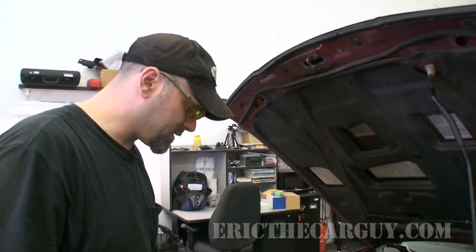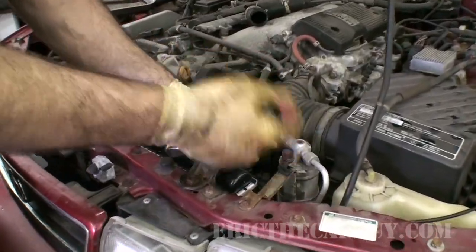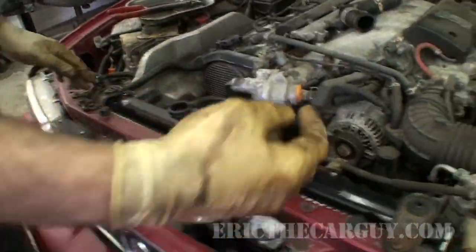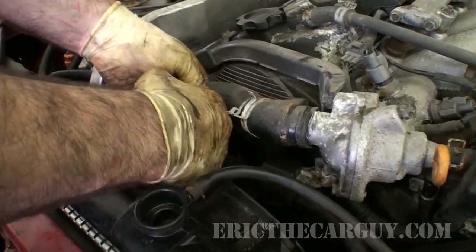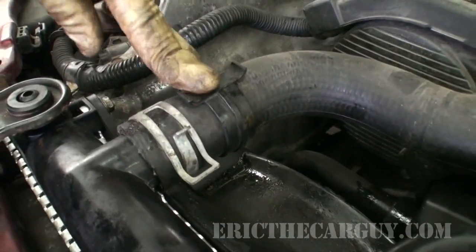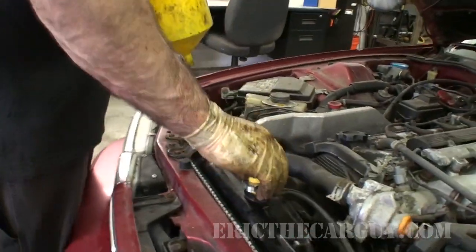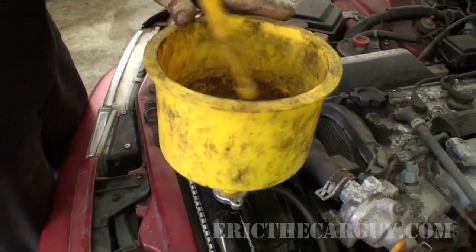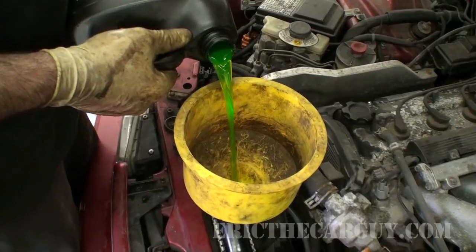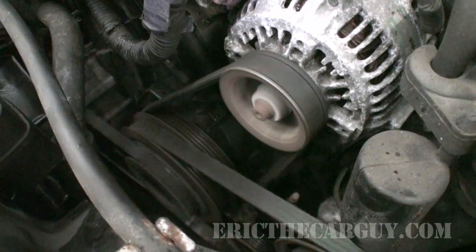Now I'm going to plug the fan switch back in and pull the clamp down for the lower hose. It's just a matter of tightening up these fasteners and hooking up the upper radiator hose again. Here's that little plastic cap for the power steering hose — this is here to keep the hood prop from rubbing on top, so don't lose this. Now I'm going to prep the system for bleeding using my trusty spill-free funnel. These old Acuras just take green coolant.